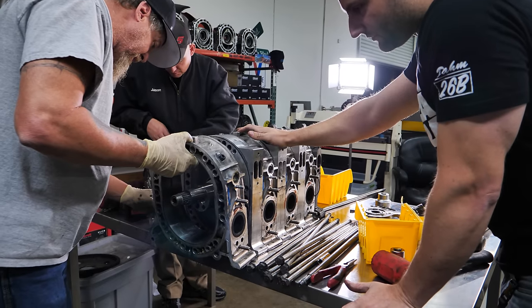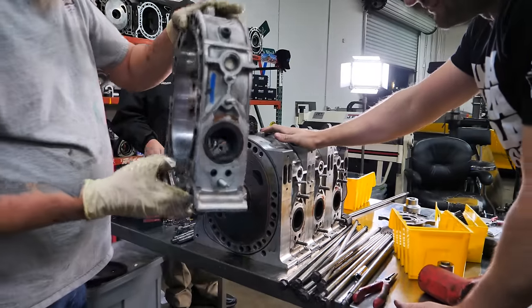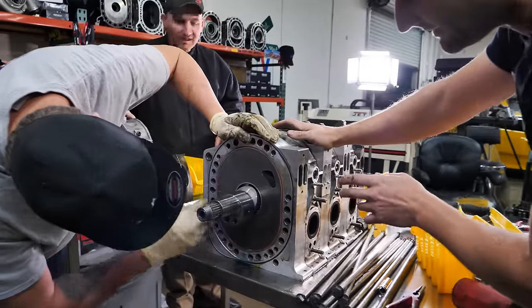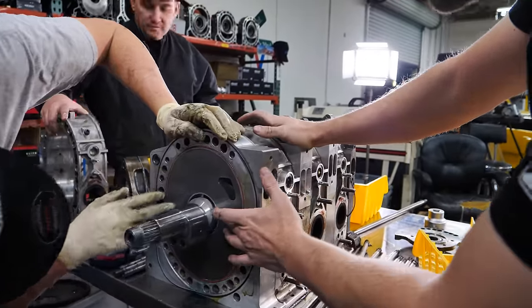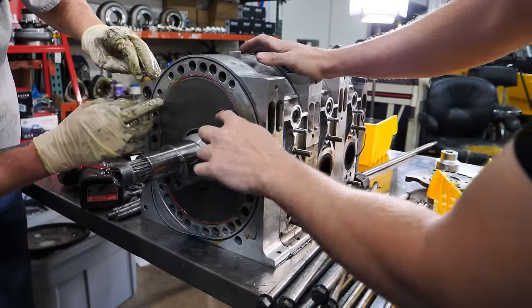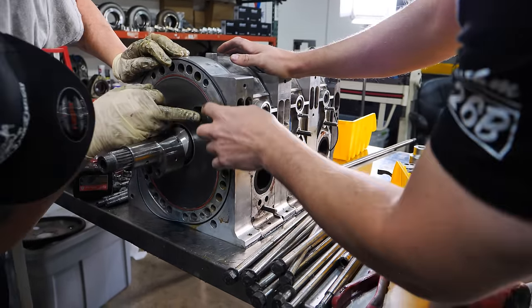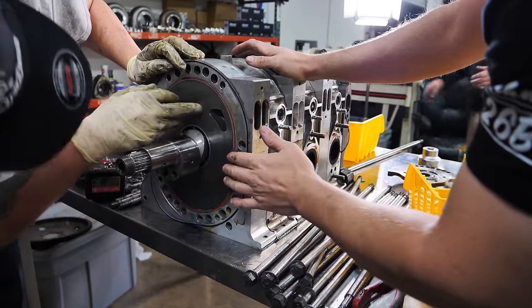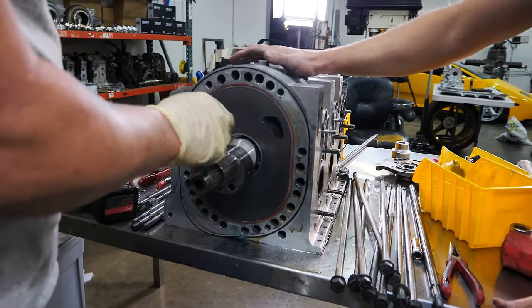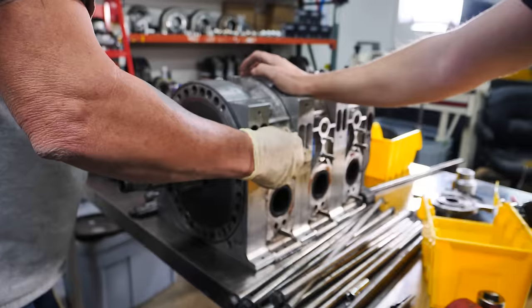Here comes the first housing — stock ports, stock. This is what I've been dying to see and I'm pretty impressed. This took a beating because of the aluminum that went in — that little edge right there — but rub some of that off and it still ain't that bad. Which side was the corner seal on? Okay — we lucked out that it didn't chew in. It didn't come apart, it stayed in there.